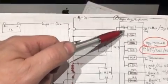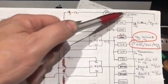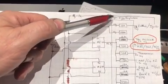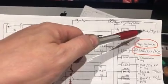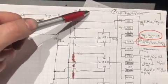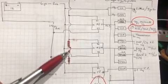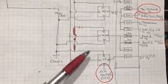And again, you can see here we've got power coming out to the ECU and to the ignition switch, and that's just a 10 amp battery circuit, so it's hot all the time. It goes through the ignition switch, which in our case is a toggle switch, and back out. I think I have 16 gauge there because I'm splitting it so many times, but you only need 18 gauge on this side of the switch to run down and feed your 2 relays, since the third one, which is why that's scribbled out, the fuel pump relay, is controlled on the positive side with the ECU.